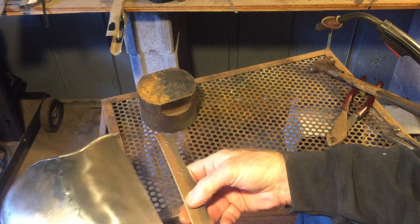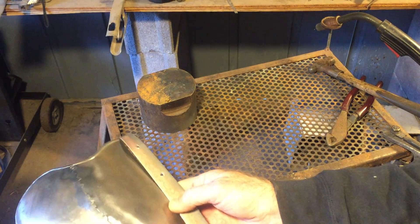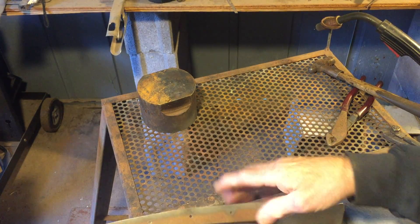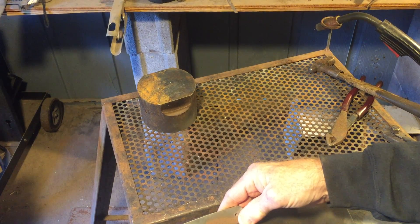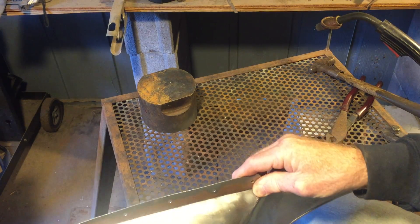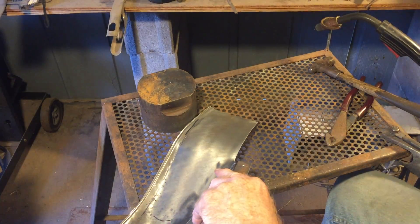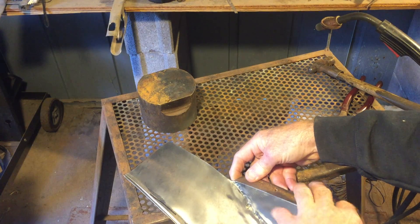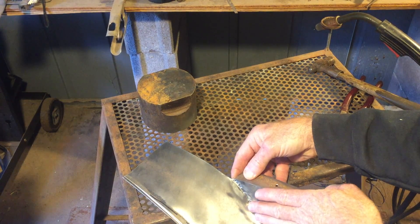What I'm going to do now is weld this inner part, which is what attaches the fender to the frame. I'm not going to worry about cleaning up this edge that much — I'm going to weld on the inside, because the only thing that's going to be noticeable is really the top part. I'll be welding it on as usual, and I've got to tack it in place first, starting with this end here.